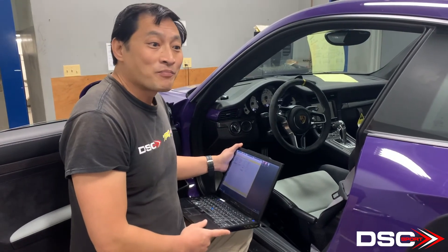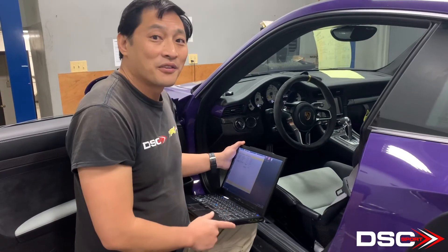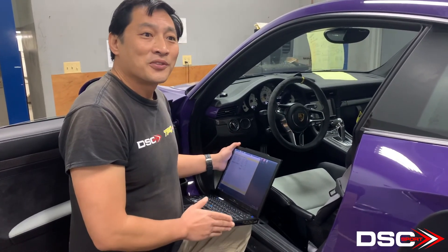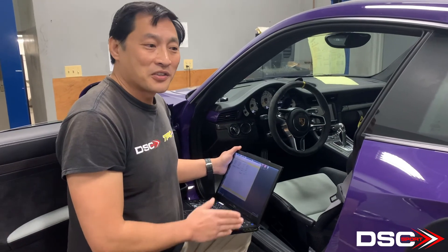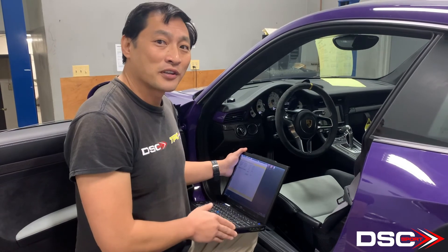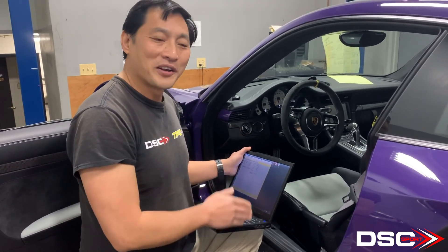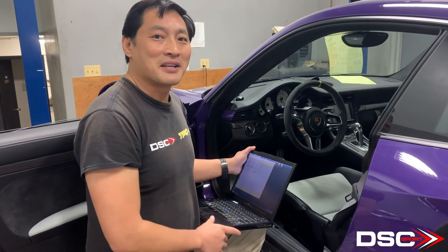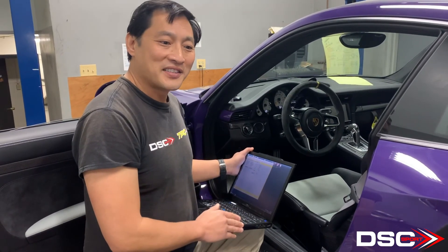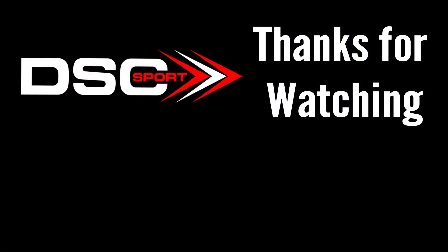I just want to bring up a point here. If the ride height of the car has been lowered by, say, 10 or 15 millimeters, it's a good idea to zero the ride height sensors, because the modules on the car — including the ABS, the FAL, and the suspension control and traction control module — do not know that someone lowered the ride height. By zeroing the ride height, it gives all these modules a zero value for their functions. We'll see you next time.